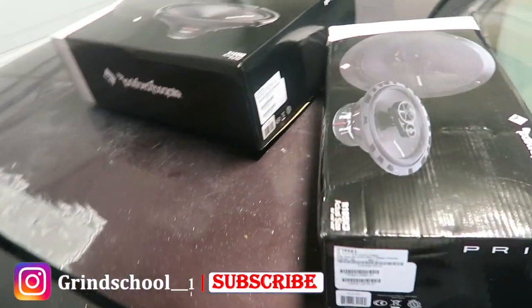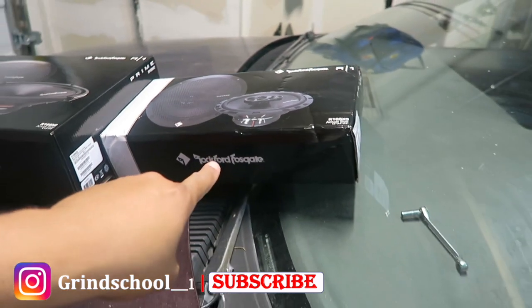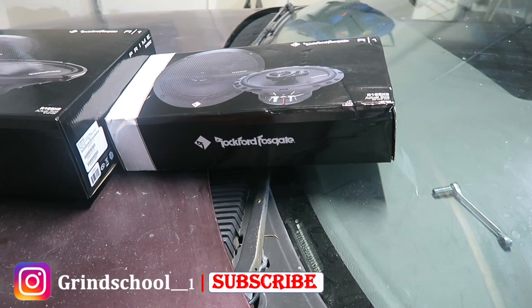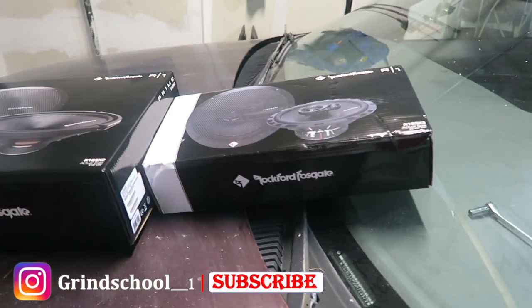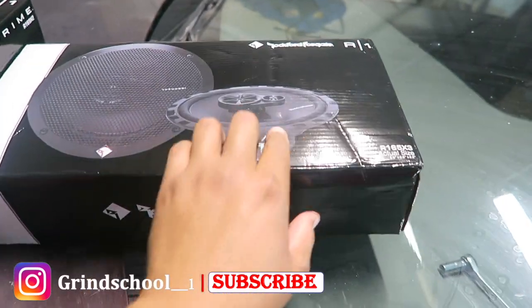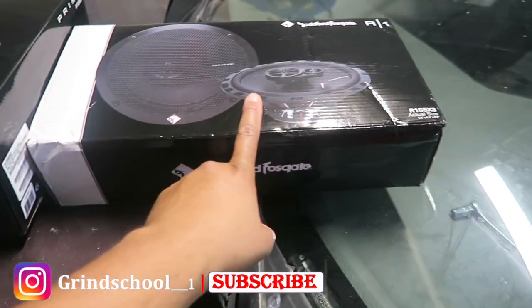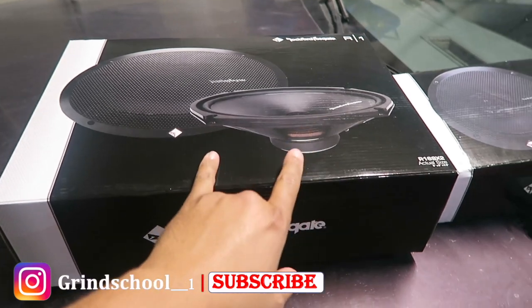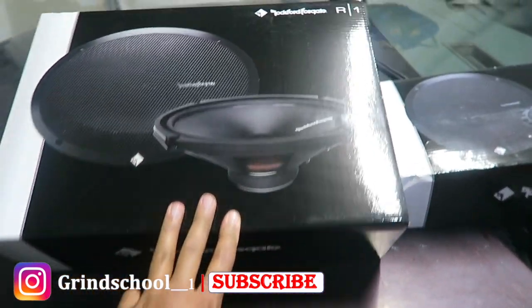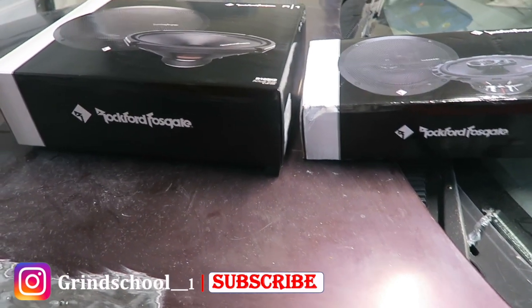What we're going to do today is install brand new speakers all the way around. I went with Rockford Fosgate because I've had Rockford Fosgate before as far as subwoofers go, and I was really pleased. I had a few P3s and was really pleased with the performance. So I decided to go with the whole Rockford Fosgate setup — the R1s with the tweeters, six and a half inch, going from a five or five and a half in the doors up to a six and a half. And I'm also going with six by nines in the back, also R1 Rockford Fosgate. I've done this plenty of times on plenty of different cars, so let's get into it.